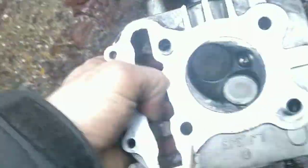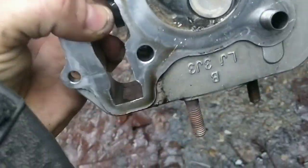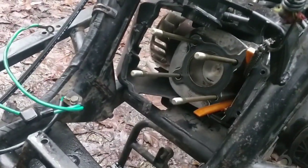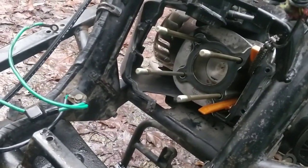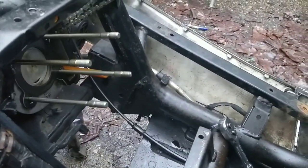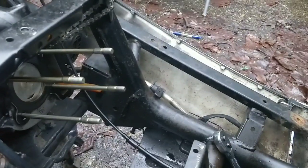Head and valves are off - this is a good start. Look - there are the guide pins. They're in this one, and I remember putting them in this one. It's the one under there that I need to worry about. We got here quite quickly with no major issues. Let's spin it and see if we still have that tight spot. Actually we don't - but to be fair, it's not torqued down.